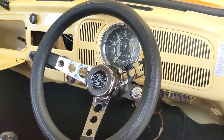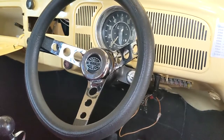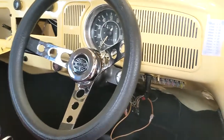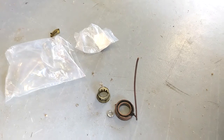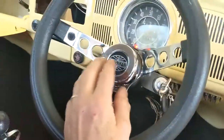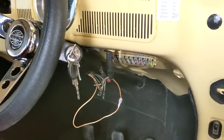Norman's all back together. I mainly fitted the new steering wheel bearing, which was causing the horn to go off when turning corners. I'd previously run a new main wire down through the steering column and it still happened, so it came down to that bearing — it was earthing out on corners. I bought it from Just Campers Online in Australia, fitted it up, and now it works beautifully. Turn the steering wheel and there's no horn.